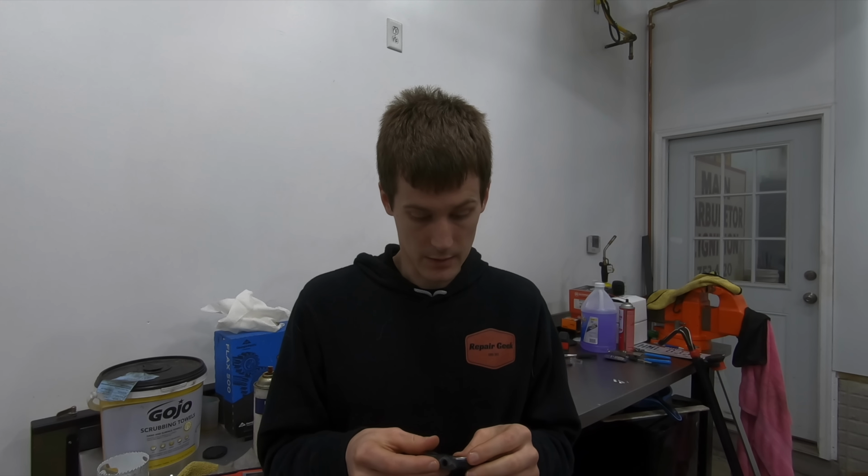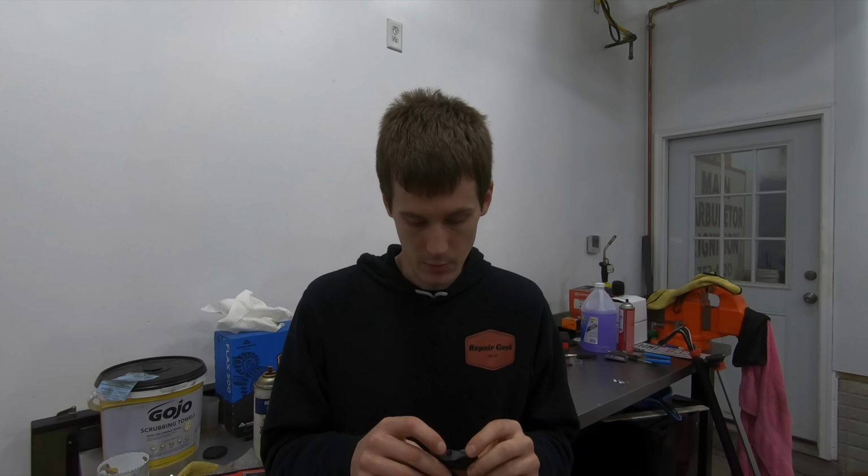These sensors I think were like 20 bucks a piece. So obviously if you buy the batteries and you're willing to dedicate a little bit extra time to this, you could just replace the batteries if you so desired. For me, it's a little bit more work than what I wanted to get into, especially when you couple that with the fact that these are 12 years old, 150,000 miles, and you take into account the number of potholes and expansion joints on bridges and things like that. These things have been jarred for 12 years. For 20 bucks a piece, I'll just replace them and not have to worry about it. But 100%, yes, if you want to desolder the battery and solder a new one in, silicone it back up, put the back on, absolutely, you can just replace the batteries in these.